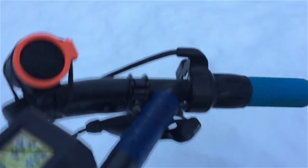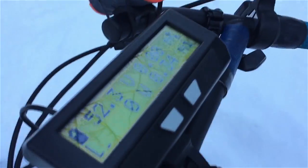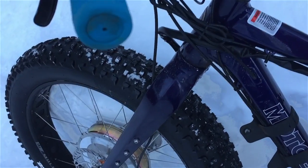That's what it looks like with the throttle activated. On the other side of the throttle, there's a green button called the brake button. All that does is cut the power to the wheel, especially important in cruise control mode. But the cool thing is if you're going downhill, you can hit that brake mode and it uses regenerative braking in the wheel, so you actually get power being put back into the battery.